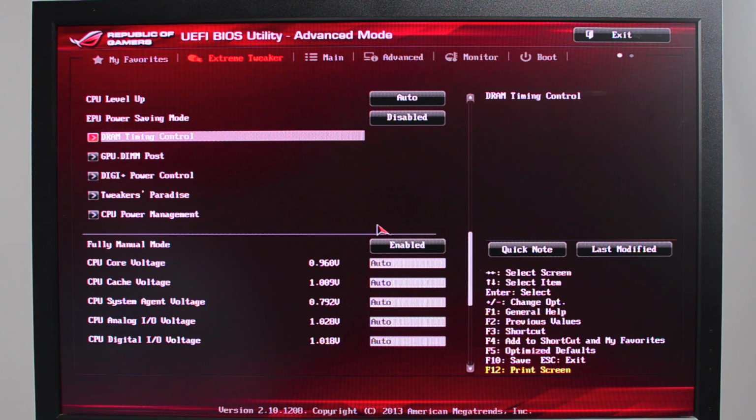So a couple of different items here. First off, you can see in the top left-hand corner, we actually have a little blinking eye. It's the ROG Pulse. For the performance tweakers that are out there, they sometimes are overclocking the systems, and the system, even within the post environment or sometimes within the UEFI environment, can lock up or freeze. So this is an immediate way that they'll always know that the system is actually still working. Okay. It's essentially always still executing something in the background.